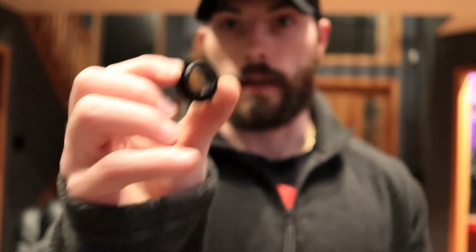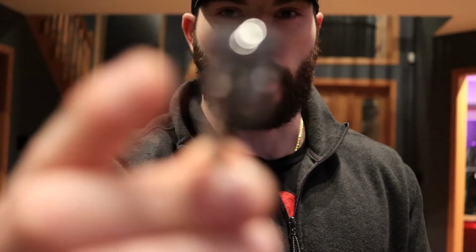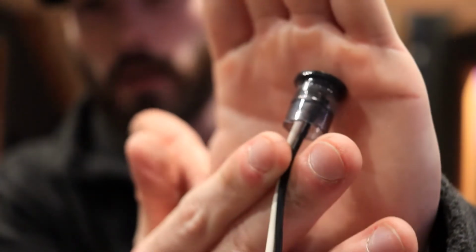So we're going to go down this route, and then I'll flip you guys down so you can see what I'm doing with my hands. We're going to end up drilling I believe it's a 1/4 inch hole. This is one of the tools I'm going to be using. This is just a step bit, and this way I can drill it to the size of this grommet, make sure the grommet fits. I might actually leave it a little bit smaller because I want it a little bit bigger than the plastic tube at the bottom there. So I'll throw you guys on time lapse, tilt you down so you can see what I'm doing, and kind of start working.